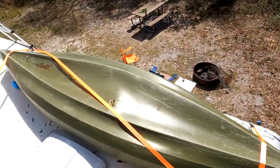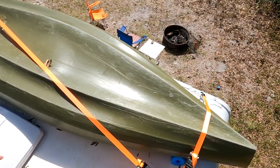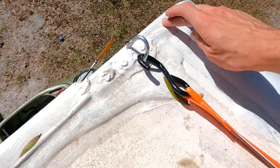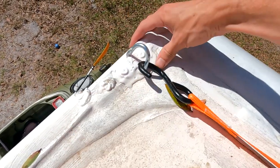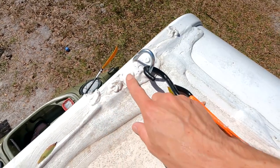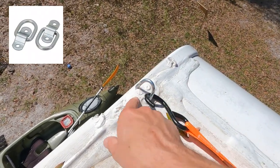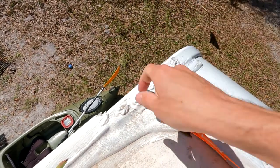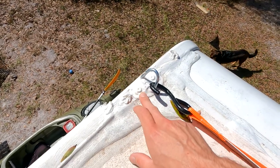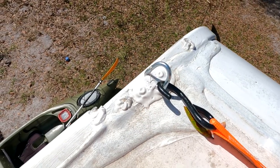With all three straps holding it down, this thing isn't going anywhere. The way I installed these D-hooks was into this metal stripping on the side so it would be real secure. First you pick off all the sealant, drill a hole, get some silicone and fill up that hole and all the bottom of this metal piece so it won't leak. Then you screw the screw down in there, and once you're done you get some Dicor or some sort of roof sealant and put it all over the top — that's what all that white stuff is — so you don't have any leaks.